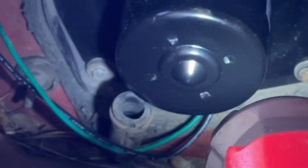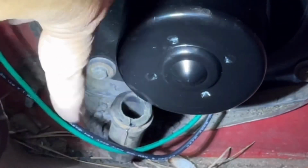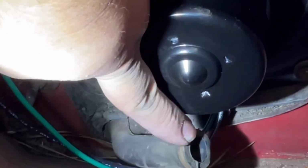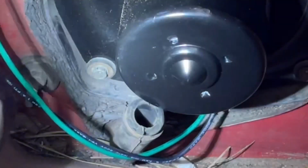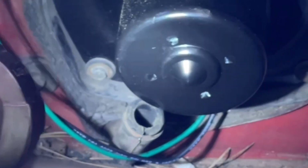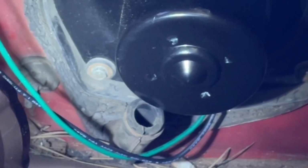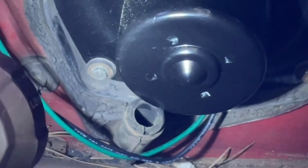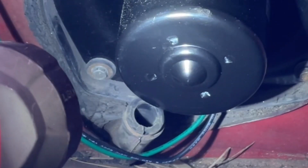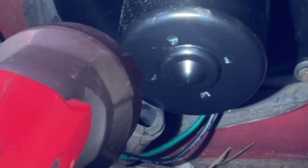See that hose on the bottom right there? Get that light to stay still. I'll just hold it right in the way, right? See this hose? This hose goes in a hole in the bottom of the vent, in the bottom of the blower motor. And that, in turn, takes a little cool air from inside and puts it inside the blower motor to help keep it cool. And that will be the motor portion of it.